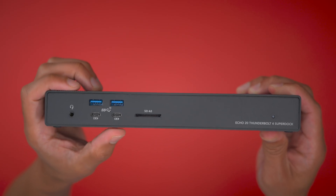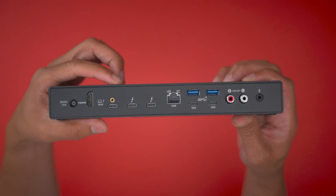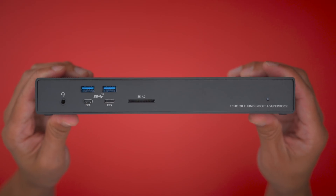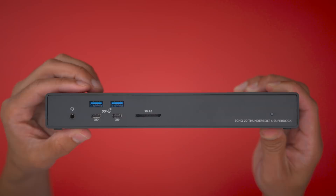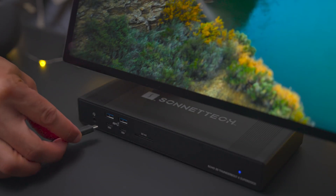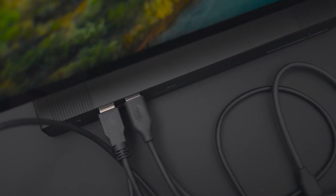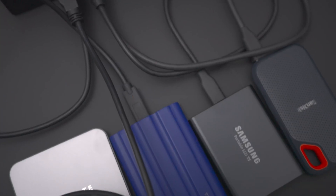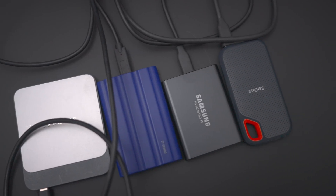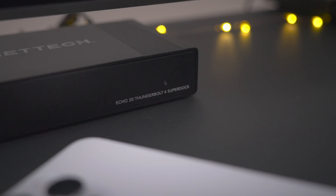Connectivity. You'll find ports on both the front and the rear of Sonnet's flagship dock. The most important connector — the upstream Thunderbolt port that connects to your Mac — is conveniently located on the rear, coupled with the DC power input, making for relatively easy cable management. On the front of the dock, you'll find half of the unit's eight USB 3.2 Gen 2 10 gigabits per second ports: two in USB-A and two in USB Type-C. Sonnet notes that each USB port supports up to 7.5 watts of power, enough for any bus-powered external SSD, meaning drives with higher peak power requirements can mount and operate without issue. The Type-C ports also support the Type-C charging specification, allowing them to charge devices even when the host is disconnected, sleeping, or off.